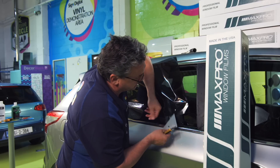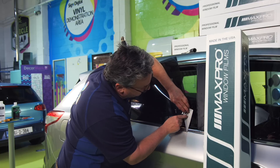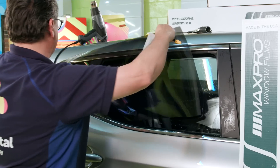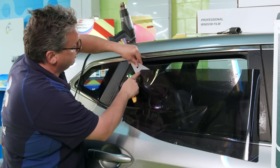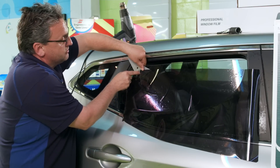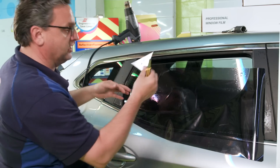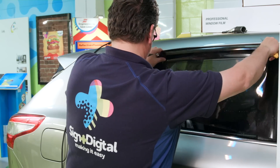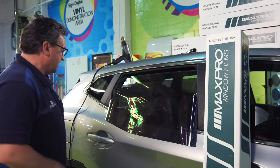Again down here, just to make it visual — cut around your finger. Everything is good. So before you do anything, check out all your cuts. How is it looking? If you have a little tiny piece of film sticking out, just trim it. Again cut in the plastic, not with glass. Just double checking, and now it's time to go in.